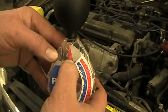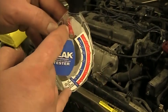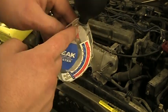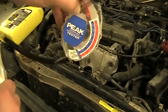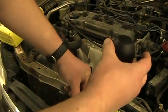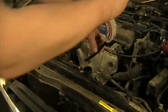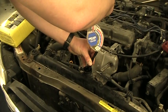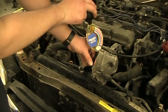There's a little float indicator inside. We have to make sure when we hold it up, that indicator is straight up and down. If you have it crooked, you can see the indicator flopping around. Give the bulb a full squeeze — kind of crush it in on itself — put it inside the radiator, and suck up enough to fill it all the way up.